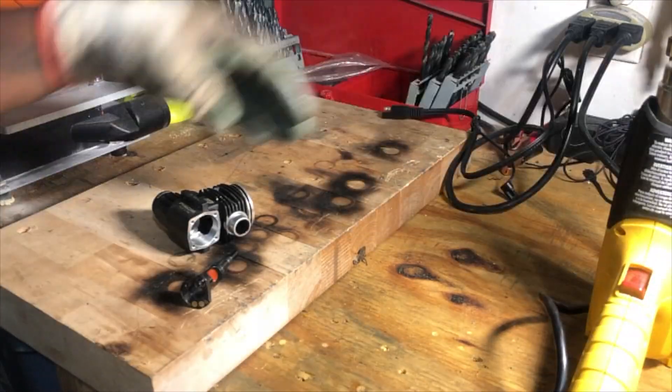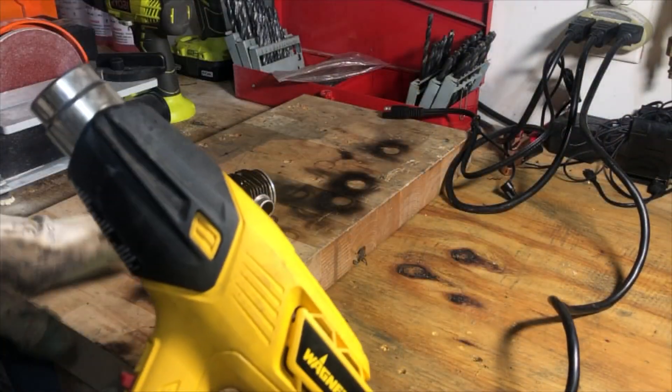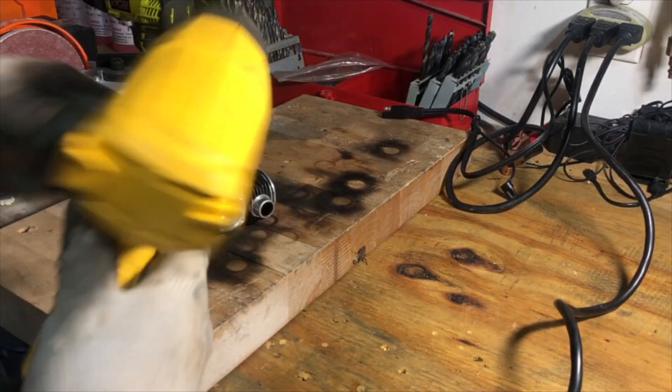So make sure you got your orientation together. When you do this, you can do it because you're going to be moving quick — you don't want the block to cool down. You want the bearings to cool down. You want everything to go in cold and hot. So let's start heating this block up. Remember, a piece of wood. Make sure you got some gloves, people.